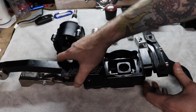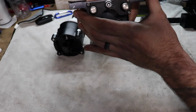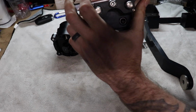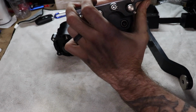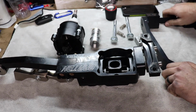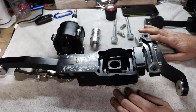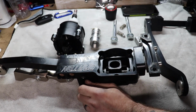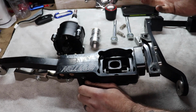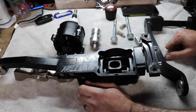So, I don't know if I can pick this up on camera, not very well, but there is rubber inside. Now, it's very hard for me to actually give this some play, but there actually is a lot of play. So, when you have this installed, completely solid. The only downside is you got a lot of vibration inside of the car. And then the NVH is a little bit higher, so you're going to hear it a little bit more too, and you'll feel it in the shifter.